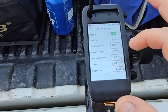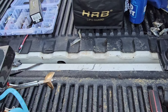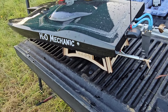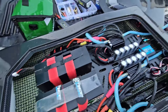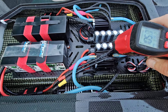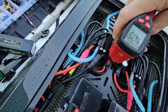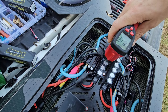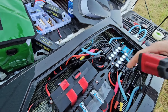Just so people know, every time I get done I reset it back to zero — just get in tune with doing that. Wow, 67 on both packs — that's kind of nuts. Let's go ahead and open it up and check the temps. Looks like the batteries pretty much stayed put, which was a good thing. Caps again: 116, 105. Front one: 120, 117. It's funny, you go back and they're colder. I guess it's getting heat from the ESC — that would make sense.